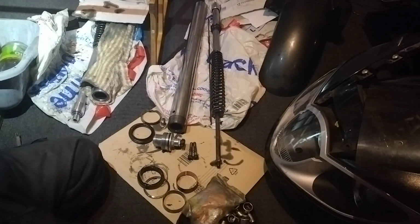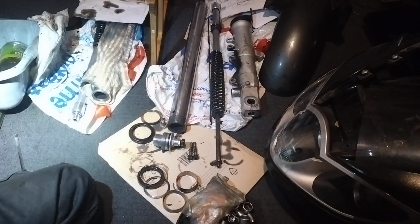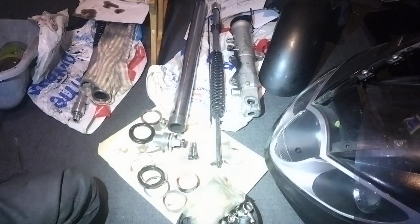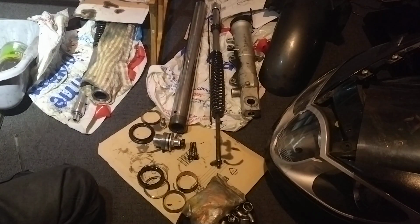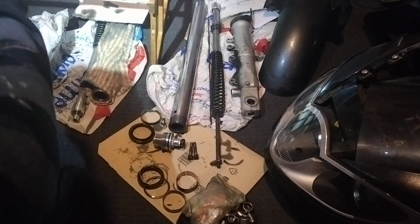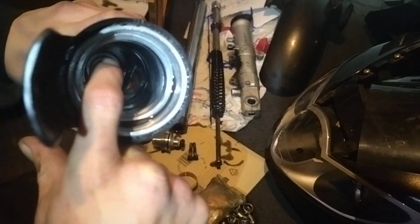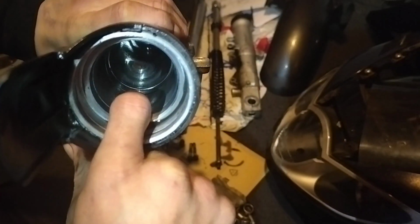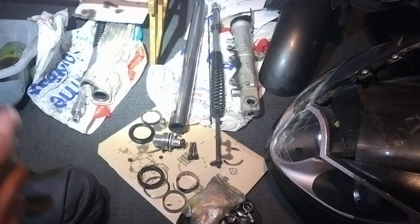And hopefully that's helpful for anyone. Also, while I'm recording this one as well, I just wanted to note, someone mentioned earlier, Yamaha's got 3 bushings, we've got 2. Most of the forks I know of on motorcycles have just 2 bushings. The one on here, and obviously the one that will be down here. On the Yamaha, they decided to put another one just a bit further down here. So normally on most motorcycles you've got the one here and one on the tube, but for Yamaha they've decided to put another one down there. Again, well done Yamaha, over engineering for no reason.